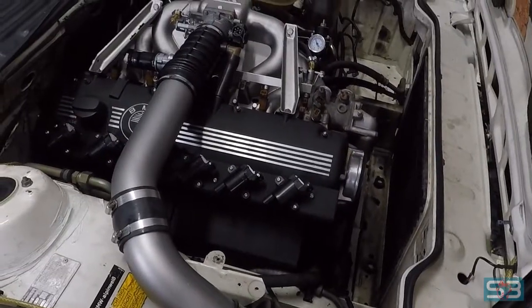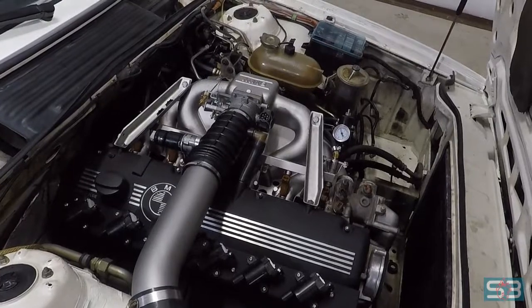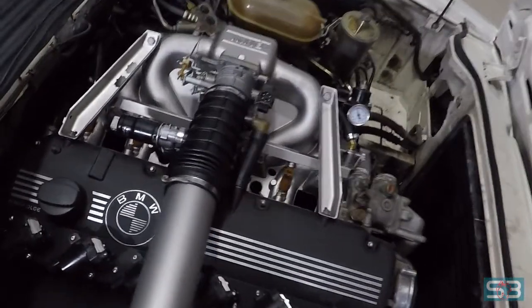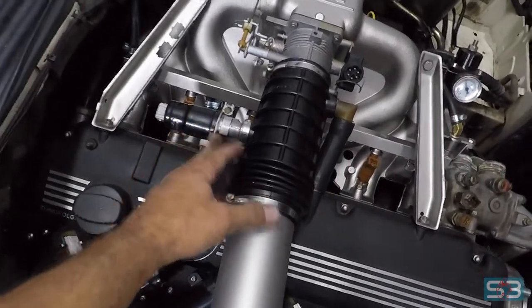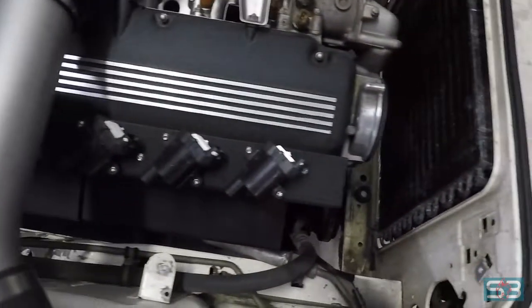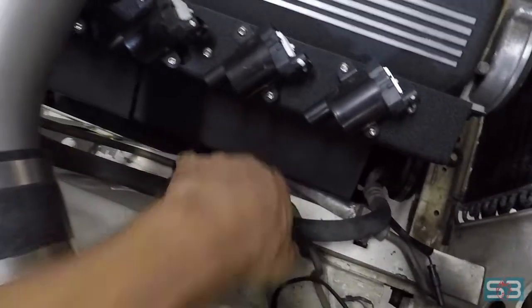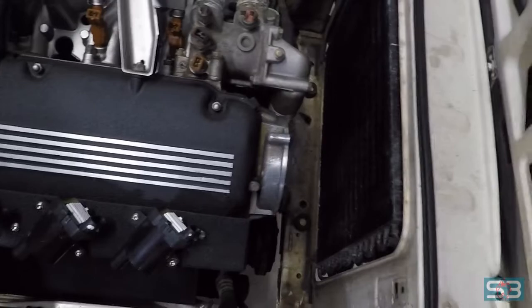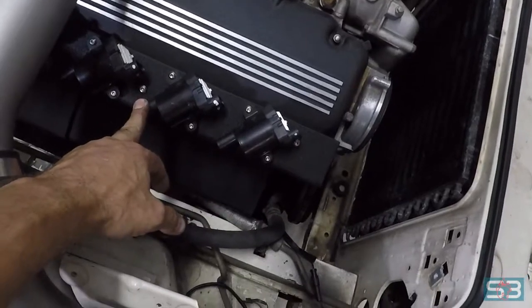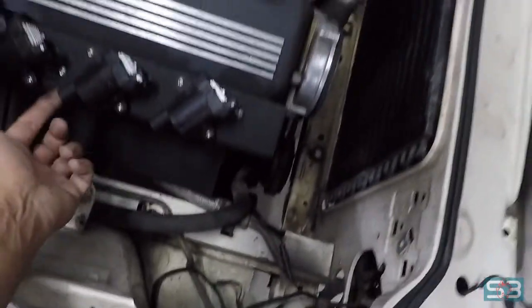There you have it — everything's done. As you can see, everything went back together really well. The lower bolts on the intake are terribly hard to get to, but it looks good. You can see the idle air valve went together. You can make out the rubber tube back here. The coil packs look really good. The bracket looks really good. The exhaust heat shield went on okay. Using my old air filter cone. Next, I'll put the cam angle sensor adapter on, then put the radiator and coolant hoses back on. And lastly, I'll use my old spark plug wires — I only need small wires for the current setup, so I'll cut those down. I've got the adapters I can show you.